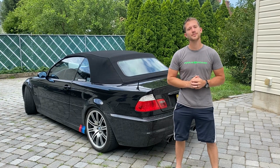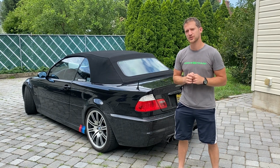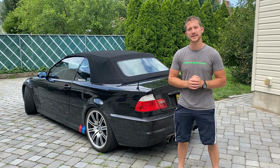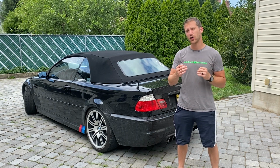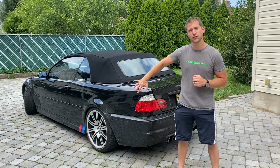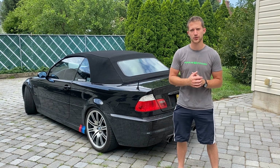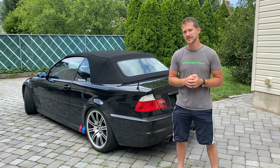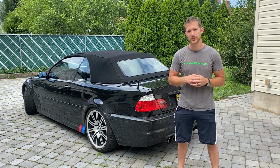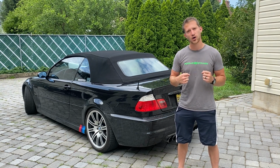Okay, let me start off by saying that this car has been ceramic coated using Adam's Polishes UV ceramic coating. For those of you who do not know what a ceramic coating is, it is essentially a very hard, called 9H hardness, coating that goes over top of the paint. It requires a paint correction and special paint preparation. Maybe I'll do a whole other video on that sometime, but it lasts 5 years. It makes the paint extremely hydrophobic, and it prevents dirt and dust from really sticking hard to the paint.